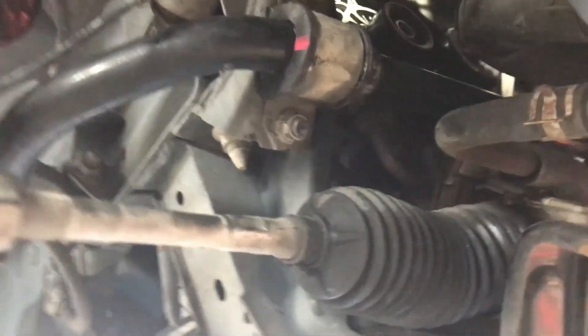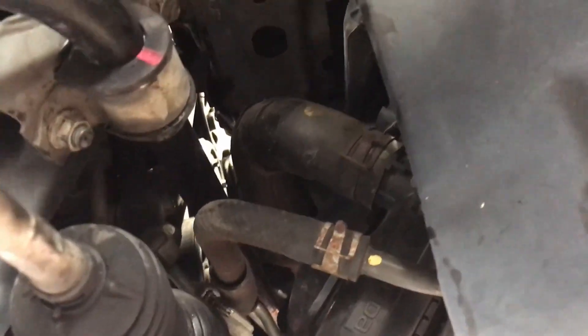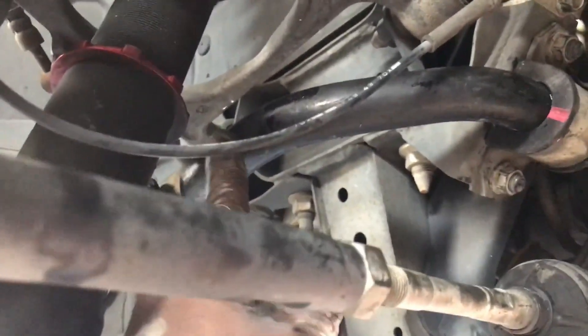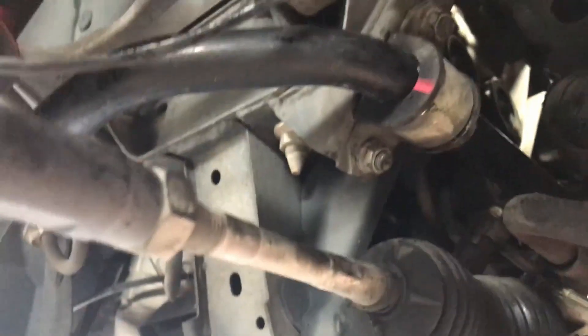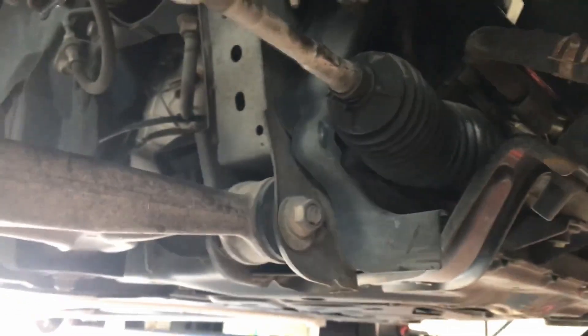Once you've got those done, you're basically going to have to wrestle against these rubber hoses for the coolant, and perhaps a couple of the rubber hoses for the power steering system as well. You want to try and get the arms of the sway bar — turning it counterclockwise from this view — and get this arm up and over the tie rod and out here. Once it's out here, you'll have to push up and almost crush into the rubber hoses, and while it's all the way up you're going to feed it down that space and pull it out this side.